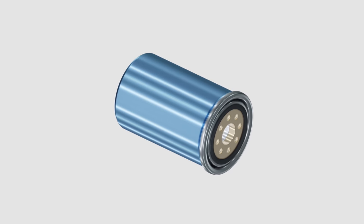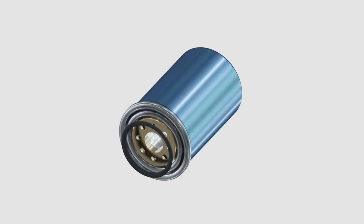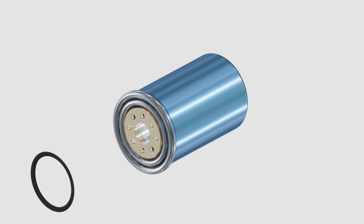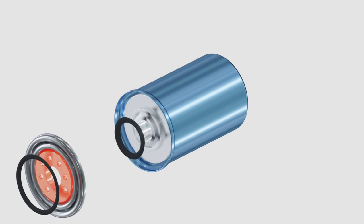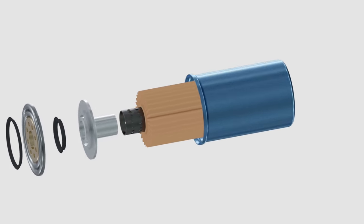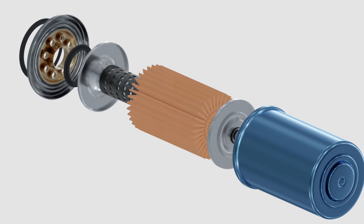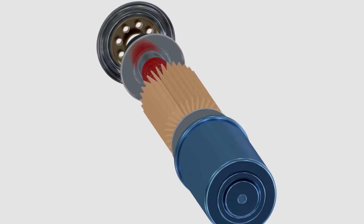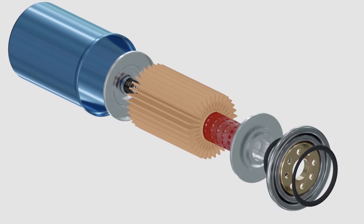Let's take a look inside an oil filter and see how it works. First we have the tapping plate — it has small holes around the edge, and that's where the motor oil enters the filter. The oil then travels through a filter material made of a mesh of synthetic fibers. Think of it as a sieve that catches the dirt, grit, and grime. The filter material is pleated to create a larger surface area within the same amount of space. The filtered oil then travels into the center steel tube, then exits through a threaded center hole of the tapping plate.